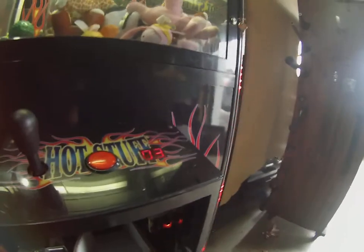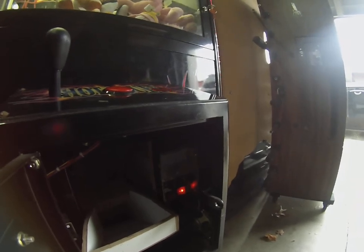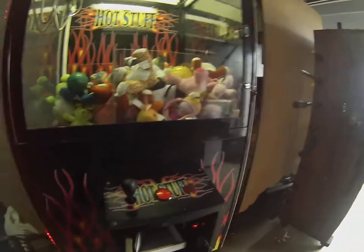And then there's number three — that is your bonus voltage. Basically you set the machine to a certain number of plays where the claw is gonna go full strength. We've got it up to 40 — full strength. So let's turn it off and flip the switch back.